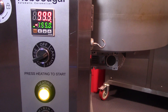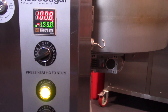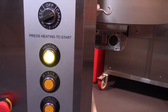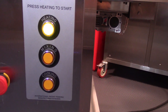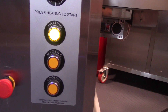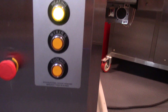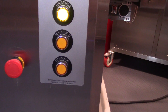In caramel mode, it's going to heat up to the full temperature — the heat's on full, trying to get there as quickly as possible. You don't really have to worry about burning. The start button for heating is illuminated because I pressed it once. Now, while the machine will automatically add popcorn to the caramel for mixing and then automatically start the cooling mode, if you've made a special variety recipe and don't want to use the standard timings, you can always push the mixing button to immediately dump popcorn into your caramel slurry, or press and hold the cooling button to force the popcorn to dump to the cooling mechanism at any time.